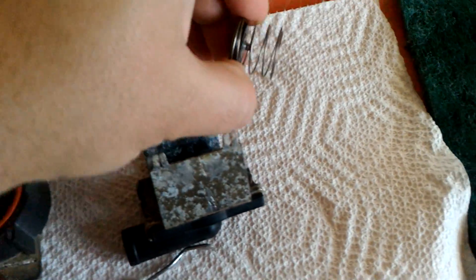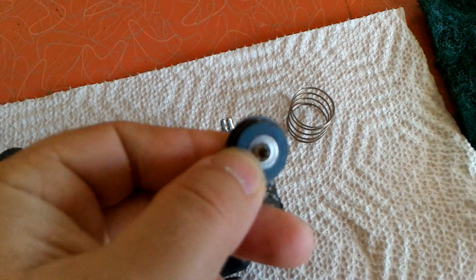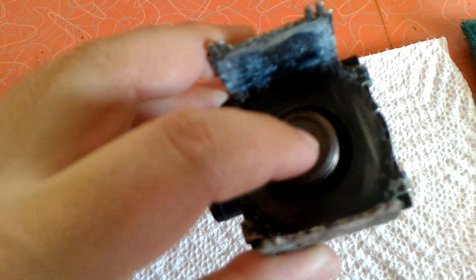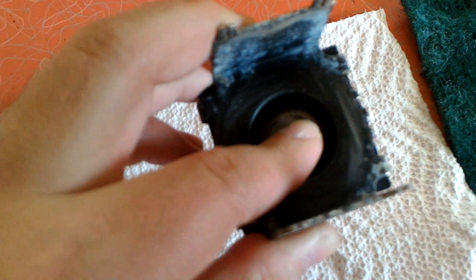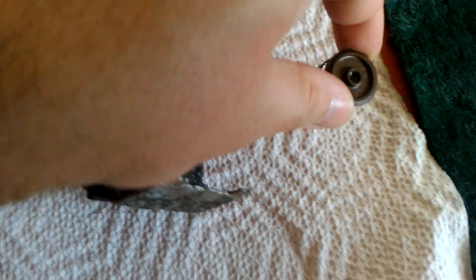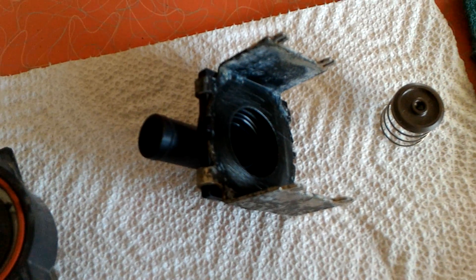This piece right here is important to explain how it works. You have a spring, you have a little plastic disc, but you also have a rubber plunger almost. This guy is going to sit inside of here, so I'll kind of do this from the side and pop that in. When this guy goes up and down, it changes whether this is sealed or not. When we press down on this, there's a nice secure seal with this rubber and that plastic valve. When the actual shut valve actuates and releases, it's going to go down, allow this spring to decompress, and the exhaust gases in the charcoal can are going to be able to go through here, end up at the purge valve, and be run through the system. In this instance, this is actually your input from the gas tank — the gas fumes go to this guy, allowing them to process and potentially be reburned in the engine.